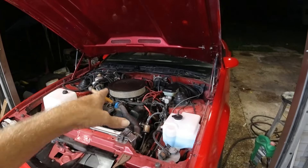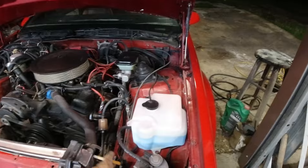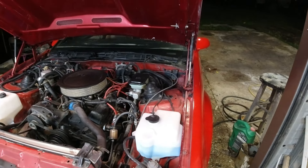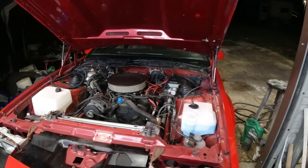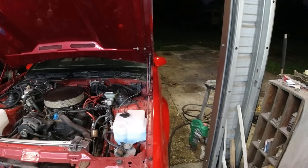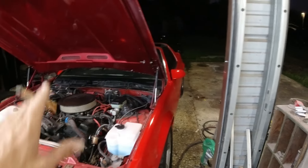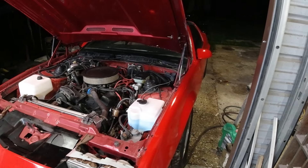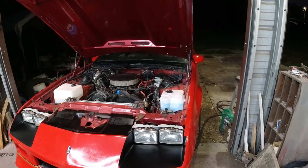What happened is what I'd call waterlogged — hydro locked. That happened in my '82 El Camino a few times because the guy I bought it from had plugged off that line, and the gas made its way up through the carburetor and into the engine. Went to start it one time and it was just click-click-click — hydro locked. Took out the spark plugs, cranked it over, and gas came out of all the plugs. I didn't want that happening to this engine, so I left the gas tank cap loose, and I think it all evaporated. Just put in about a gallon and a half — going to need more gas before the test drive.